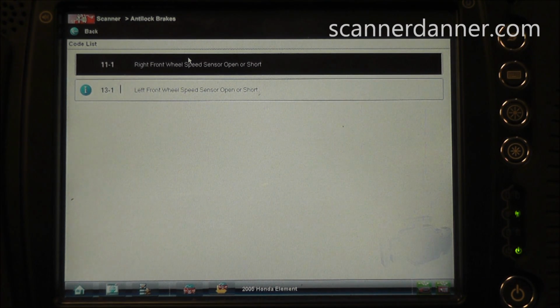So what that tells me is most likely pin 16 has power, and we're talking on this network. So I'm not concerned about a data link problem in this case, or a misidentified vehicle. I am definitely worried about engine and transmission and why these aren't talking to us. So we're going to move now away from the scan tool and away from the data link connector, and we're going to go toward main powers and grounds at this engine computer. Remember, this thing just had an engine replaced, so of course the grounds are a big concern here.